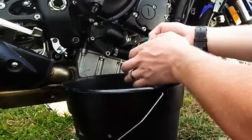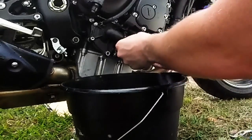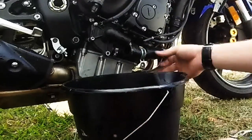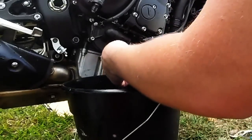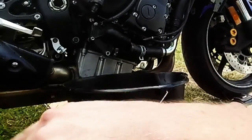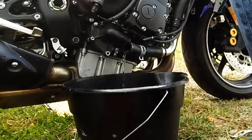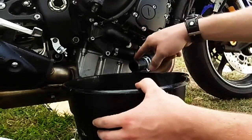So I kind of flushed a little through there. The next thing you're going to do is move this hose clamp back on the hose to get it out of the way. Then you've got to pull this hose toward the front of the bike and let that drain. In the manual, it says you can use tap water to flush it. And there's like dirt — like sand — inside this hose. So I'm going to pour just a little bit more water through with that hose off.